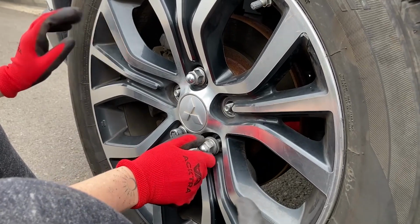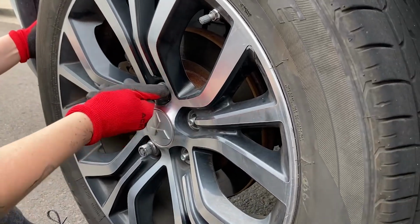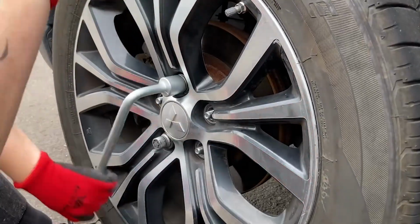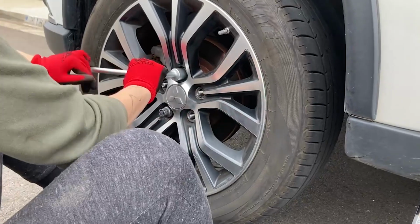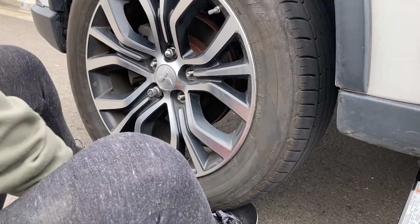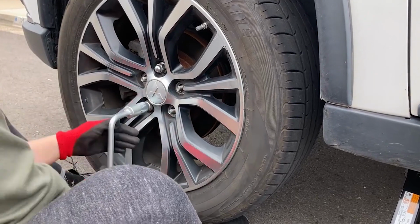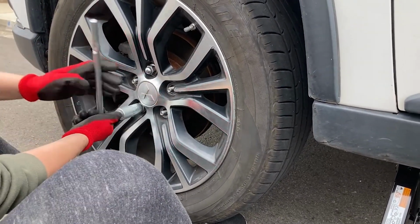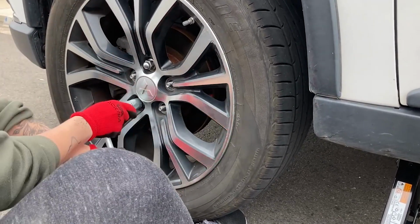Now, before we keep going, let's go ahead and get those all the way hand tight. Hand tight. Yeah, so hand tight, but you can use the wrench. Perfect. Nice technique. Cool. That seems hand tight. And then you're gonna need the key for that one. And that one you can probably just do by hand because the key extends it for you. We're here. Done. So once those two are hand tight, then I would start to star pattern the rest of them.